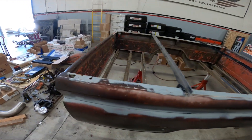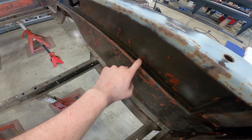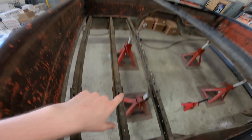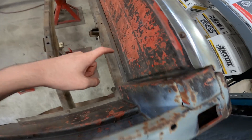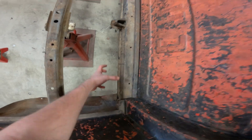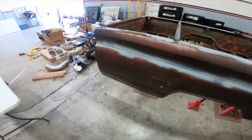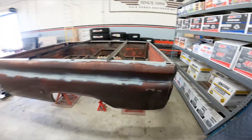There are a couple challenges with cutting this thing apart. We ultimately want to split it on the body line, which is held together by spot welds along this flange. But I prefer to do that once this whole bedside is loose. I've already WD-40'd all these front bolts to remove the front section. This U-channel — the rest of it is gonna have to get cut out, what's left of the carriage bolts. Thankfully the tailgate is just two bolts on either side. But this U-channel, this beefed-up back one, has got four bolts on the other side so we'll have to blow all that apart. Once this bedside is loose we can set it down, grind off, find the spot welds and easily split them, then make our body line cut continue out through the front and the back. Easier said than done.